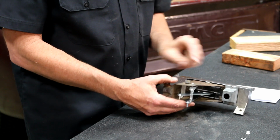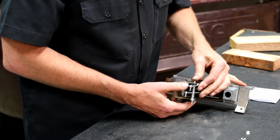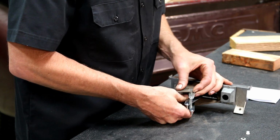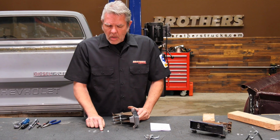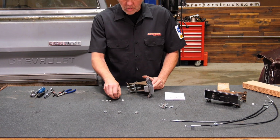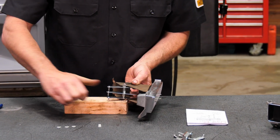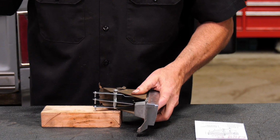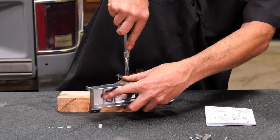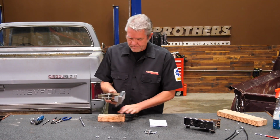It's hard to dangle everything all together. Then I'll get the last spacer and slide it in there some, get it positioned up pretty good. Then pull down the rod just enough to get in there. Things will shift around on you a bit, but it's not too tough. Notice these little clips right here. You've got three small holes and one with a larger hole. The larger hole is going to go right on top of that pin there. I'm going to use a little 2x4 on the bottom for support. Put that on top, and I'll get a little socket that's just a little bit bigger than the pin and slide that down on top. And now I've got this nice and firm. Everybody's moving freely and good.